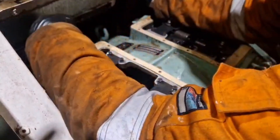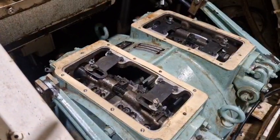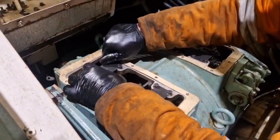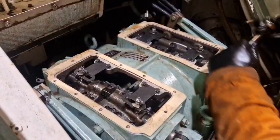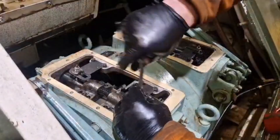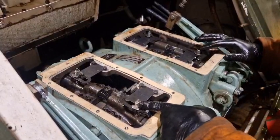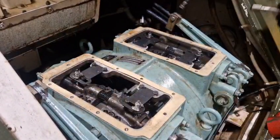That's the left nipped up. Okay, try again — they feel good, spot on. All I've got to do now is nip up the top adjusters, then get them to try again. Pulling both back evenly — that's it, beautiful, all done. All I'm going to do now is put the security tabs back in, put the covers back on, put the 7/16 bolts back in, and that's it — job done.